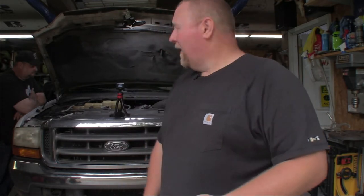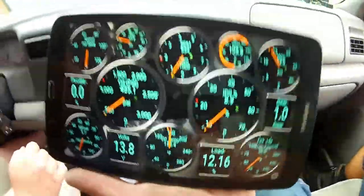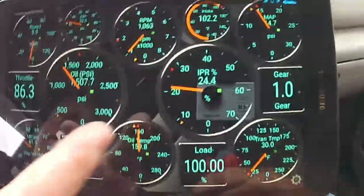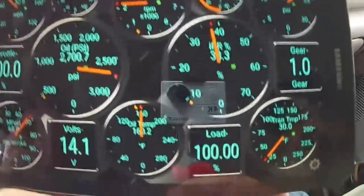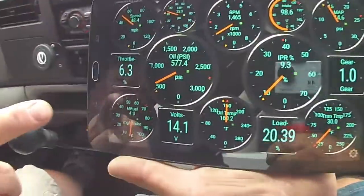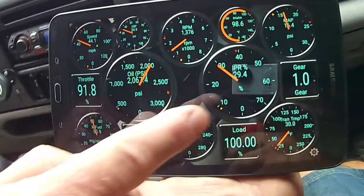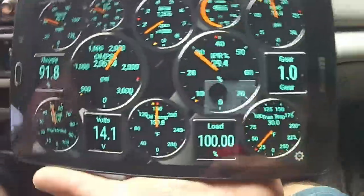Next up, we're going to run down the road and just want to see what it does, how it acts, how it feels. Riding down the road, I just want to see what our injection pressures look like. I want to go to a high gear and ask a lot of it. Look at your pump — yeah. What that tells me is your high pressure oil pump is doing what it's asked. Usually if you stay in it like that, you'll see pressures start to fall off. What we're seeing is this duty cycle percentage here is pretty low, so it's not opening that IPR valve very much to make all the pressure it needed to make.